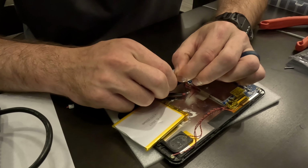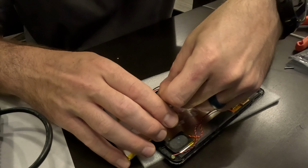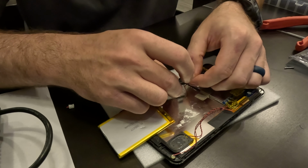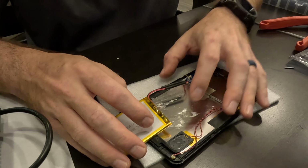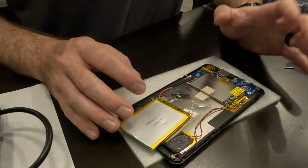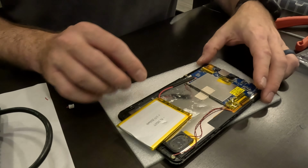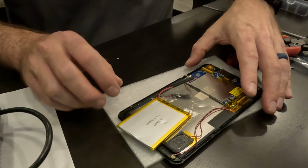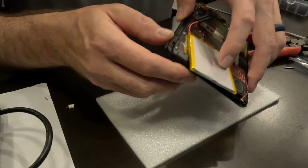And so before I heat shrink this tubing, I'm going to cover the connectors up, but before I shrink it, I'm going to do a test power on the tablet to make sure that everything's still working, because I'm kind of taking a huge gamble here doing this. It may not be successful. Alright, so let's go ahead and do a test power now. My power button is going to be this one here right next to that ribbon connector. So here goes the moment of truth.